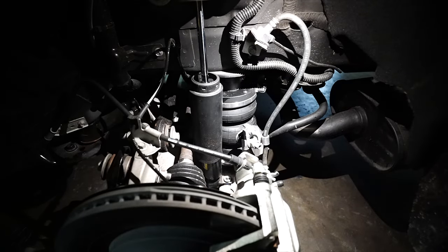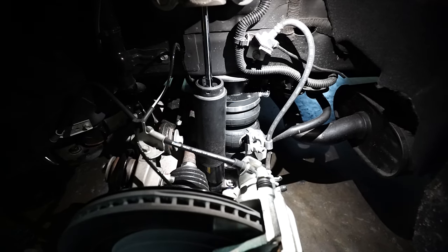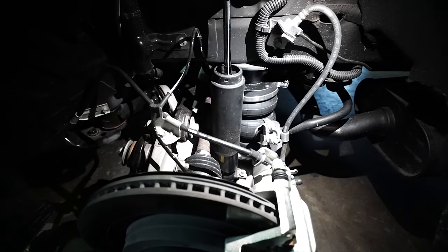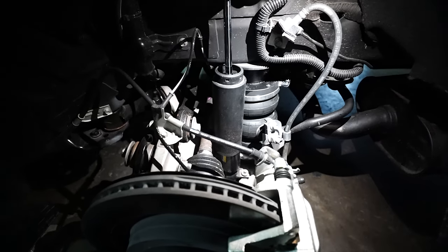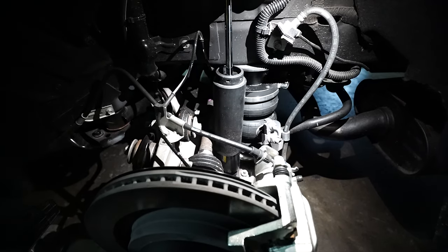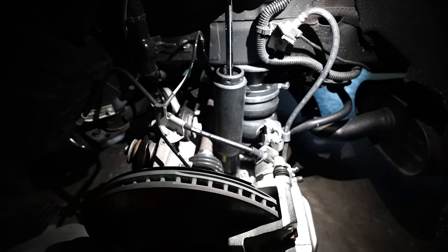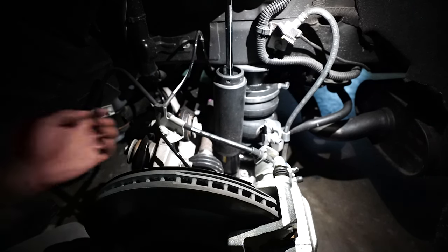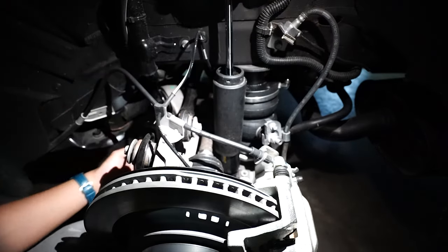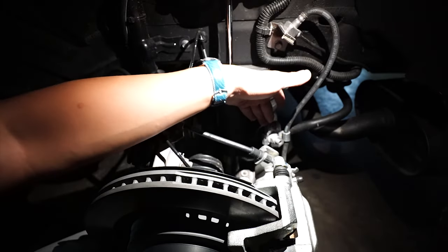Hello and welcome to the rear suspension of the Ford Mustang Mark VI S550 chassis — this is the updated version of our catalog video. From the previous one, the suspension is the same. This is a divorce-type layout; it's a multi-link rear suspension. As you can see, there's a lot going on — it can be a bit overwhelming to look at if you don't know what's happening. We have an upper camber arm, a lower control arm, a toe arm, and the sway bar stab link.